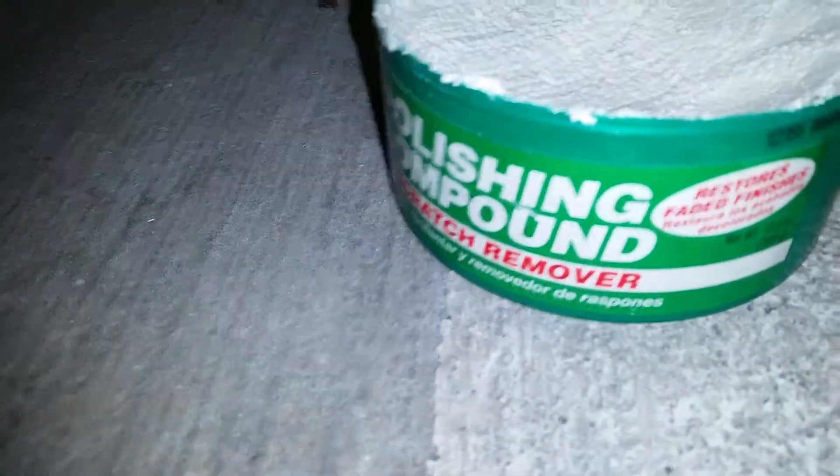This is basically what the bottom trim looked like, so we went from this to this. Compound first — only if need be. Compound gets all this rough stuff off. Mother's Gold, spray it on, wipe it down with the clay bar. That basically shines it back up and gets all the small fine residue out of your paint — that's what the clay bar does, in combination with the spray. Then you put a wax on it.